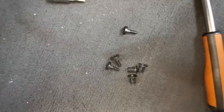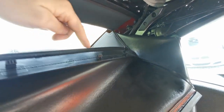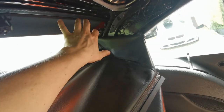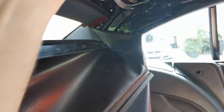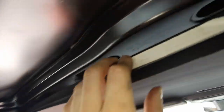These three screws are plastic — I think it's Torx 25 — and they have little pop-thread rivet things that come out with them. Then you basically gently pull on ten little retention clips here — ten noses facing each other — and just gently pry it off and pull it out of the panel. Now in theory there shouldn't be much holding this on. There's a shim in there that didn't want to come out — I'll remember that. It's still captured by the rear of the roof.